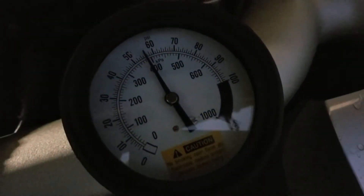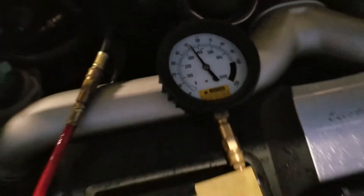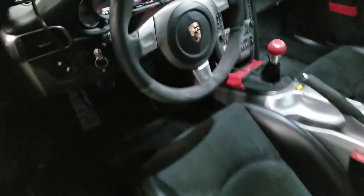We need to be right around 3.9 bars, which is roughly 56 psi. You can hear fuel pressure coming through there. When I stop the activation it goes back down to about 52 psi. When the car idles we're right after 60 psi.